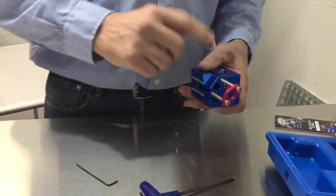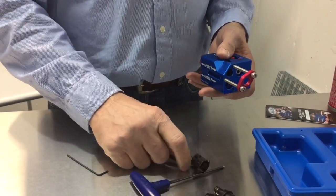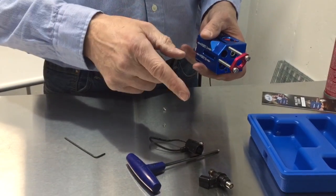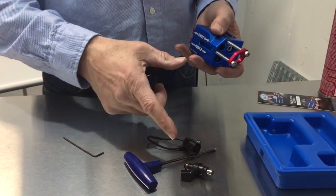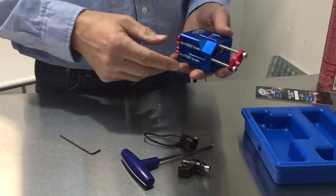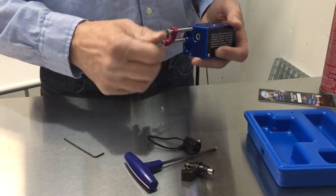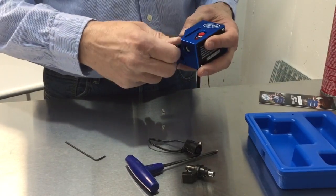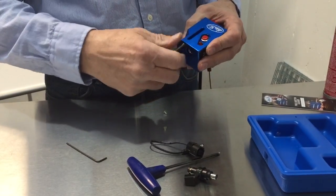So what that battery is for is this has this pigtail that connects from this cleaning tool to the injector, and the battery sends voltage to that so it can open the injector so that you can clean it properly. You can't clean them if they're not open. So from there, you unscrew these 2 Allen bolts to put the injector in. And these long slots here on both sides are just for the bolts. That's the only purpose of them.